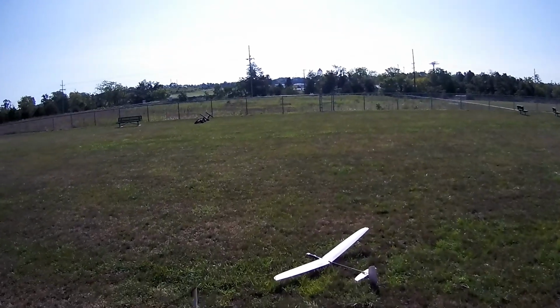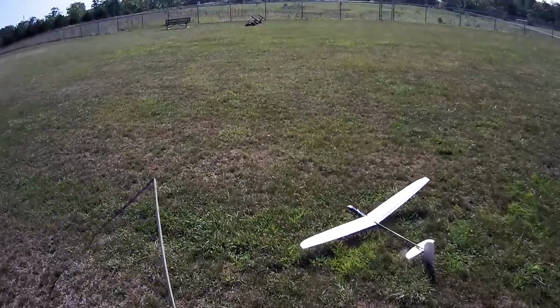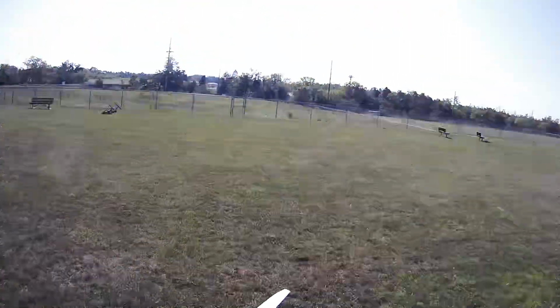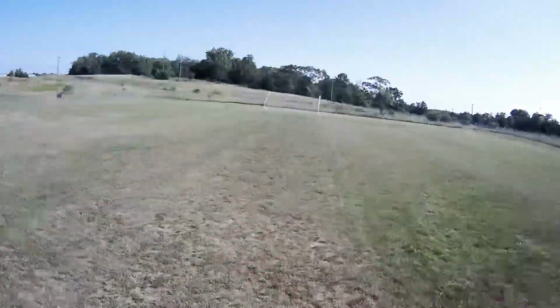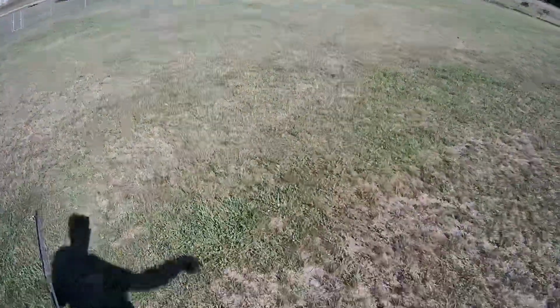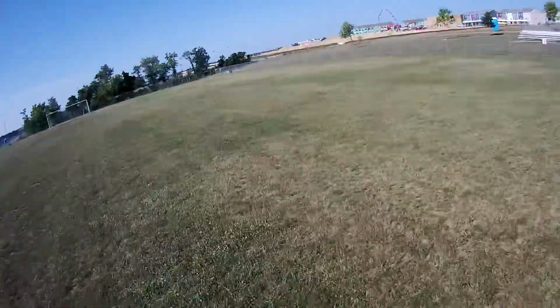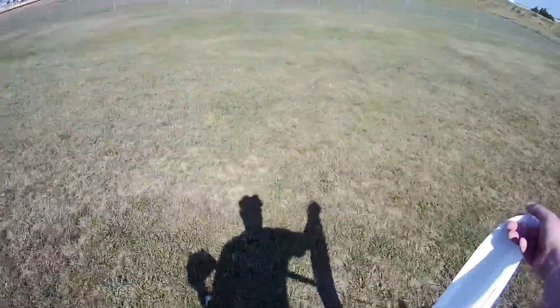One of my left aileron servos is double centering pretty bad because these HTX 500 servos, they suck. But they're like $4 and I had them for a long time and they're glued in, so I'm not going to break everything apart on this thing to glue a new servo in. I'm just, whatever. I will not be using them ever again. I've said that before, but I didn't want to put any X06s in this thing because it's just not meant to be.